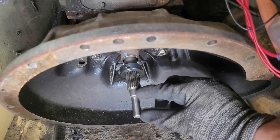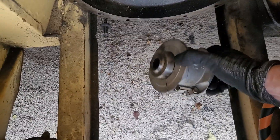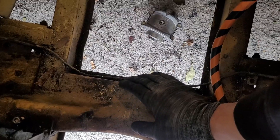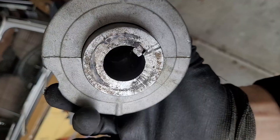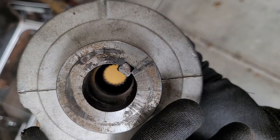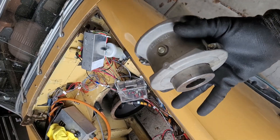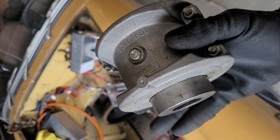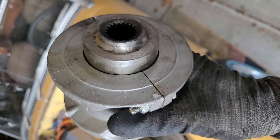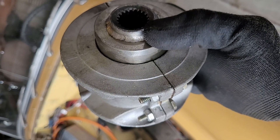This whole part here sticks out and isn't needed, so I could cut that and end up with an inch shorter coupling — which might allow a longer motor. The end on the motor is a bit odd; you can see the keyway — the key is shaped like a T because the motor key is bigger than this key, so that's how it's been adapted. Overall this is kind of huge, and I don't know if this outer clamp piece is necessary — it might be able to be eliminated. They appear to have welded the clutch pressure plate on here to get that spline.